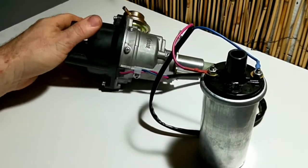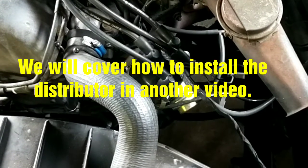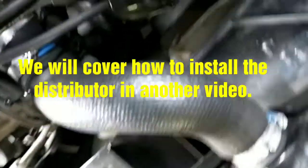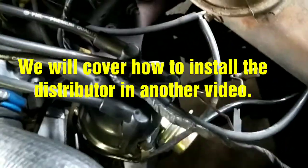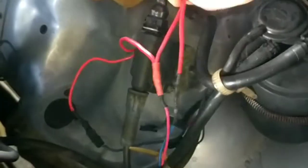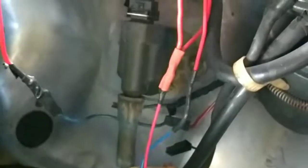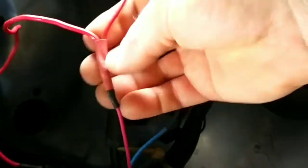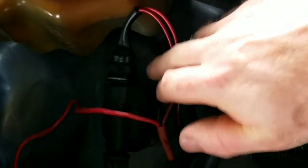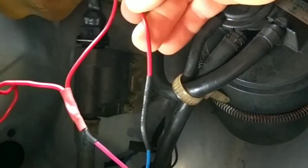It will look pretty much like your points distributor. Here is a similar distributor fitted to the Datsun 720. You can see the wires just go over. In this case I've used the E-Series Falcon coil. I've literally tapped into the loom — I've just found the right wire to run power, cut into the loom, and added the plug for this type of coil. Pretty basic.